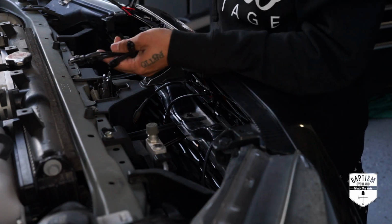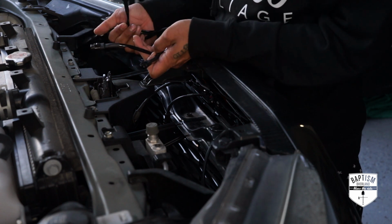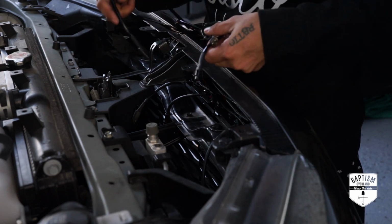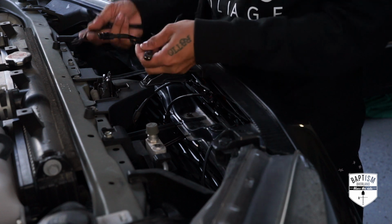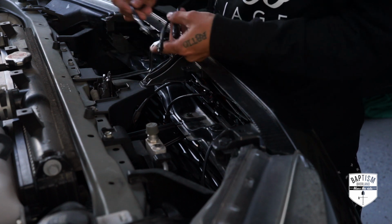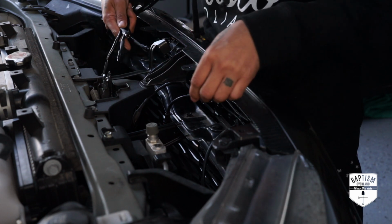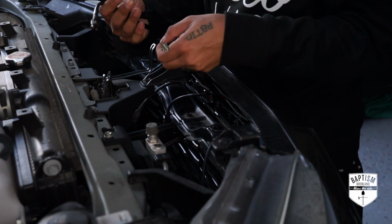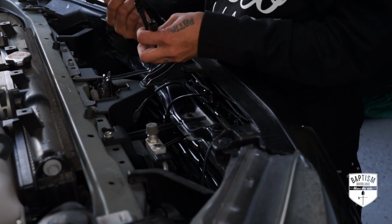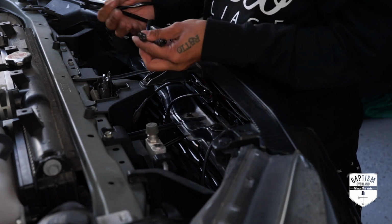For the inside, you just take the loom that they sent you. On one end of that loom, you'll see 4 plugs, and these 4 plugs plug into these 4 lights. So when you start wiring it up, just make sure that you are not putting this anywhere where when the hood closes, it's gonna squish it. So we're just gonna go underneath, but it makes it easy. You don't have to splice it in or solder in yourself. They're already ready to go and just plug and play.